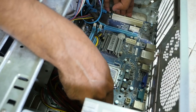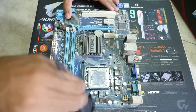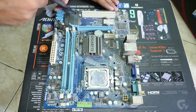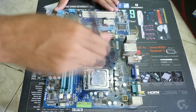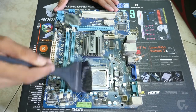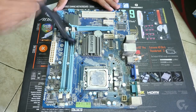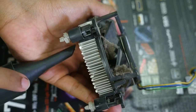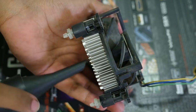Pull out the motherboard and keep it on a non-metallic surface — I'm using a motherboard box in this case. Use any type of brush; if you don't have this brush you can use any dry toothbrush to clean the motherboard. Just rub the motherboard with the brush gently — do not use any force. Once you think the motherboard looks clean enough, use the blower functionality of the vacuum cleaner and all the dust was gone after five minutes of hard work.